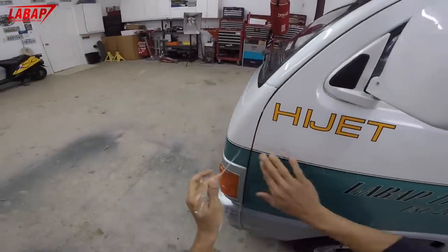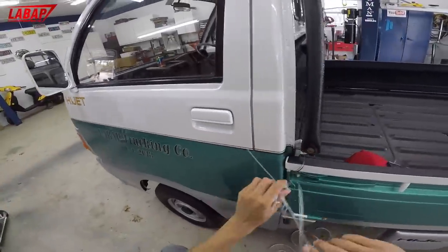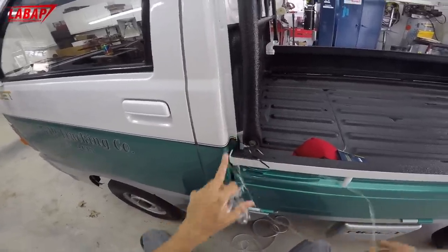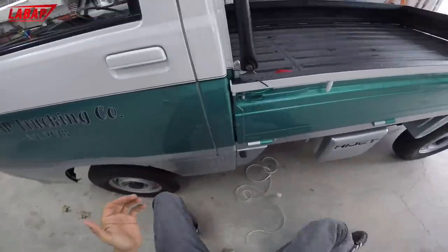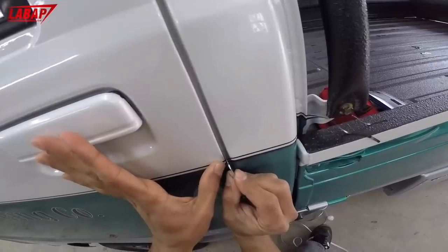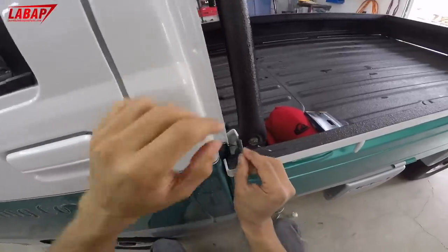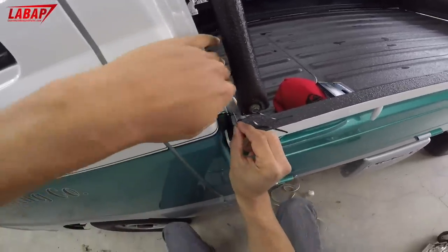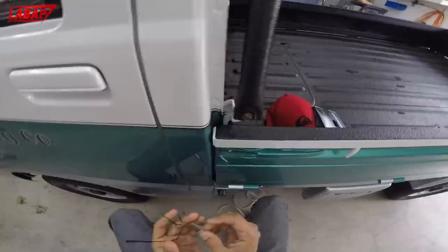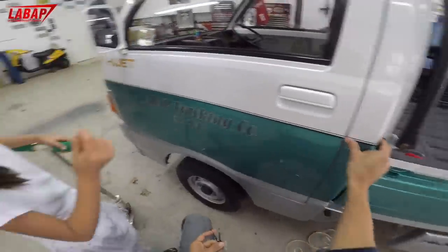We're putting some cool pinstripe on here — it's called Pro Stripe, a really easy vinyl pinstripe for quick custom details on your paint job. A lot of people like this on classic cars; it's much easier than painting and brushing on pinstripe. Make sure to cut the gapping areas before you open your door, otherwise you'll pull the pinstripe and mess it up. We went all around the truck — the bed and bottom section on both the silver-teal and white-teal areas.